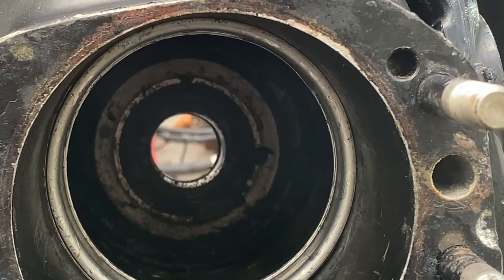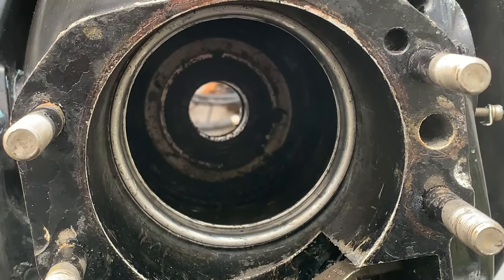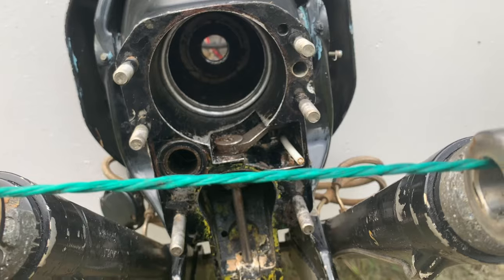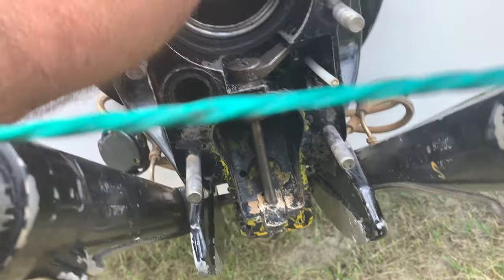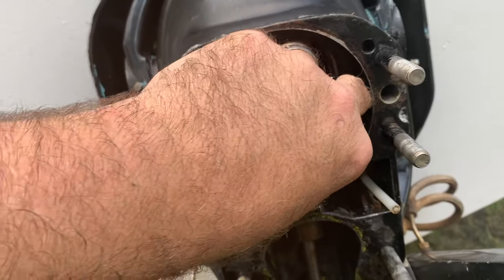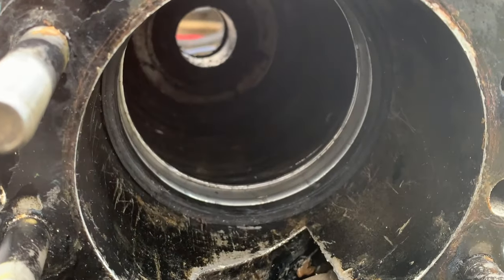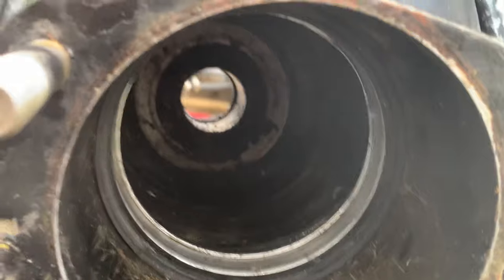so there's no water intrusion. And now we just got a small O-ring that we put in front of that helps compress and make it watertight. And then also here on the outside, when we install the outdrive, we will have another gasket. All right, in place, and that just slides right here in front. We're just gonna set it in there. That's it right there. See it? There it is. So that's nice in place now, and that'll be ready to receive the outdrive.